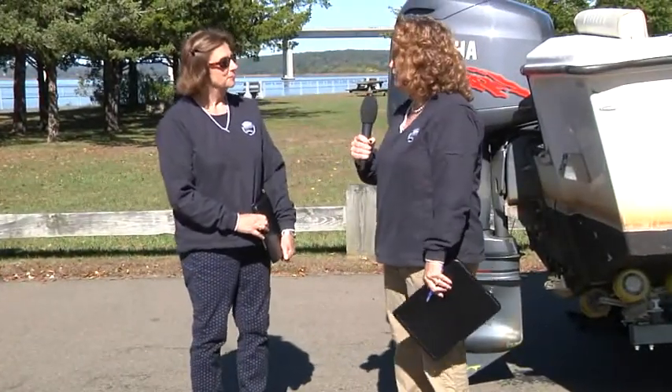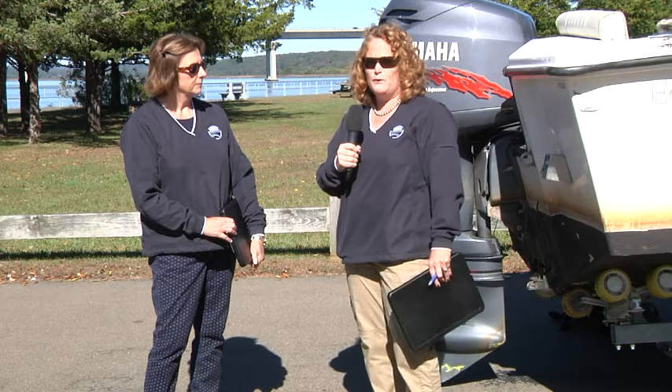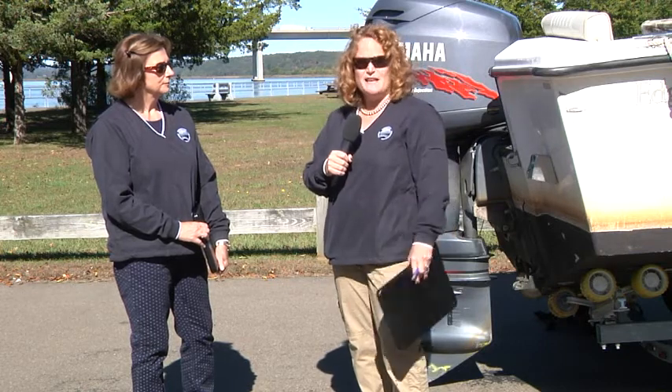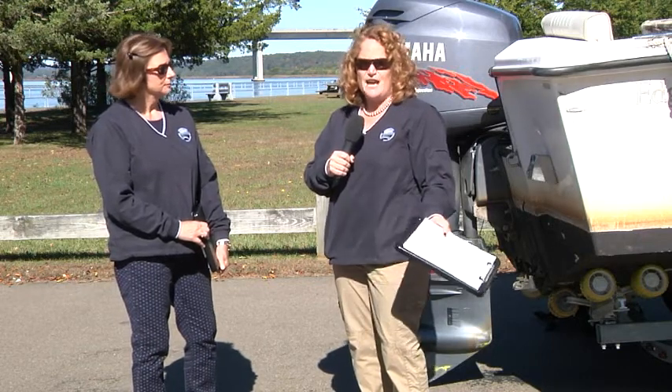Thank you, Eleanor, for coming back and co-hosting this show with me. The last time we were out here was right before we launched our boats and we were talking about spring tune-ups and what to do about launching. Here we are — it's a little bit cooler, but we still have a beautiful day. So just to go over a couple of points: some people are going to keep their boat in the water year-round or haul it out. We'll first address hauling your boat. If you have a trailer, that's the easiest way. Remove your boat with your trailer and make sure that you remove the drain plug as well. Then we recommend that you pressure wash the bottom, the props, any shafts, rudders, or trim tabs that you may have.